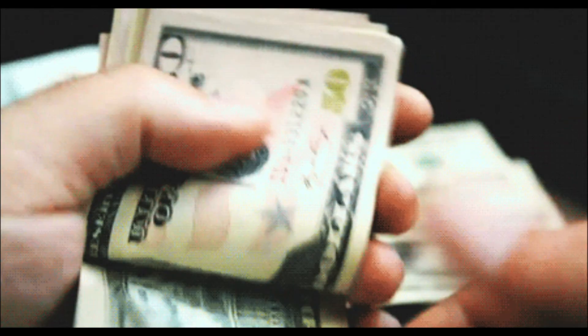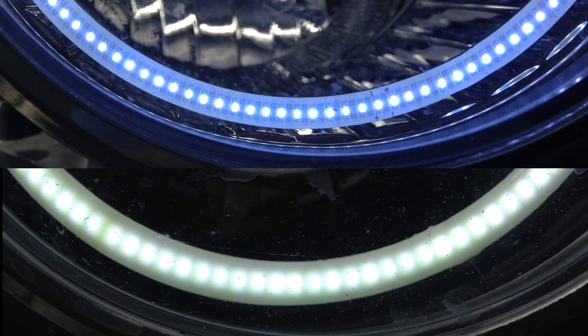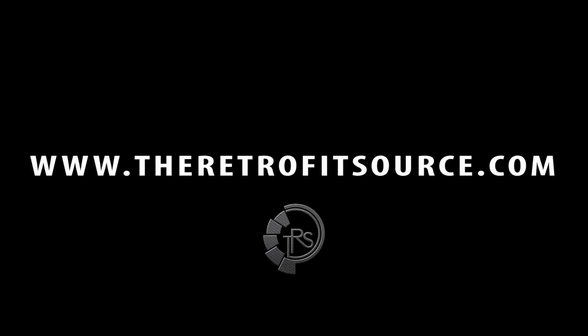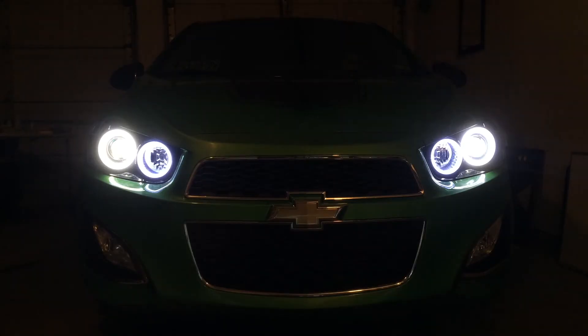Now for a word of advice: if your headlight application can use 120mm or bigger rings, use them — they are much brighter than the smaller sets. Also, if you're going to be buying rings, try to buy all the same size, because you don't know whether the LEDs used to manufacture that specific size will be the same color or even the same size. Don't hesitate to call theretrofitsource and ask them for information on what the halos look like before you even order them. Well, that's all I've got for this review. Thanks to TRS for the outstanding customer support, and thanks for listening. Keep those headlights shining and drive safe.